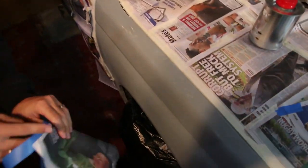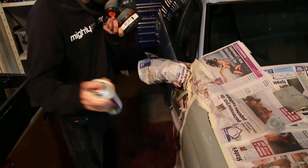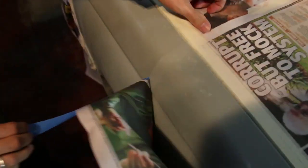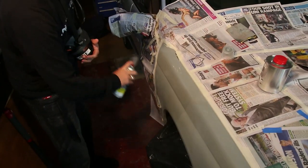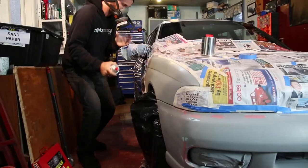Probably the most common mistake people make when repairing and painting panels is they try to just mask off part of the panel. If this part of the panel down here is fine, they'll mask all of that off and then dust the paint on. What you'll see, even with just this example, is once your paint's done and you pull it off, you will see a massive line going down the panel. The way to actually fix that is either do the whole panel — which is what we're going to be doing — or if you only need to paint part of it, blend it in by dusting the paint, getting lighter and lighter as you get up near the undamaged panel. Blending is an art in itself, but for us we're just going to do the whole panel.